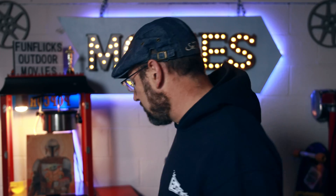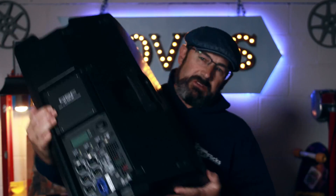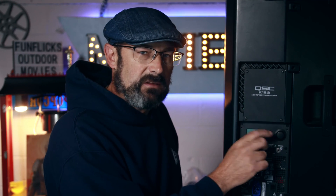To do the update, you're going to have to connect via USB. If you look on the back of your speaker, you're not going to see any port to plug into. However, it is there — you just have to remove something. Here's one of the 12.2s. Look at the back of the speaker: you really cannot see any USB ports because it is hidden under the adjustment knob. We're going to take that knob off.